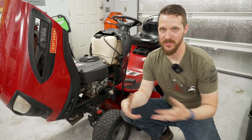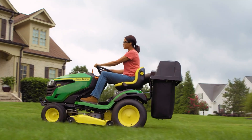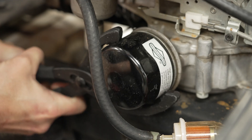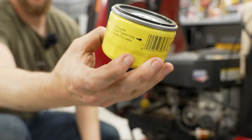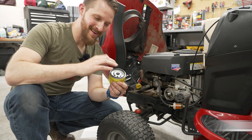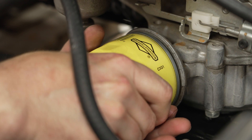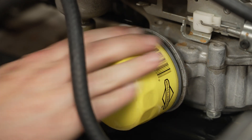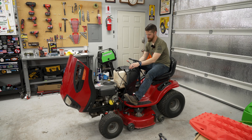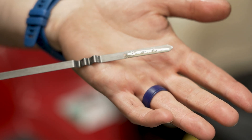I should definitely change this more often — I was doing it once a year, but I need to do it twice a year. Very similar engines to this one are used in lawn tractors from Craftsman, Husqvarna, John Deere, and Cub Cadet. Once all the oil is drained, remove the old oil filter. Here is the new oil filter — apply a little bit of oil to the rubber gasket, then thread it on. You don't actually want to use any tools to tighten this; just do it by hand. The oil capacity for this engine is 48 fluid ounces. Pour most of that in until you read some oil on the dipstick, then run the engine briefly to cycle oil into the filter, then top off until the dipstick reads full. Oil change done.